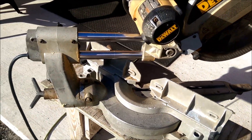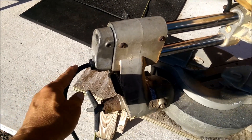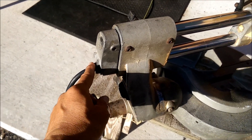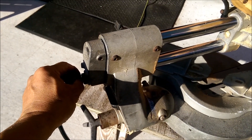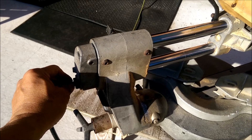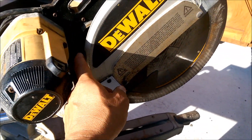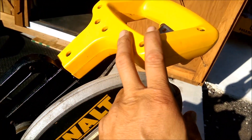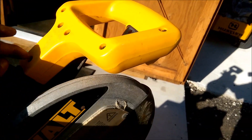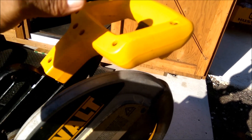So for a quick recap: the plug coming out of here got frayed over time and it was exposing one of the wires — actually both of them were becoming exposed. What I did was I ran a channel here, chased it through here, it comes up behind this panel and inside the handle housing. You take out the torx screws and the handle half comes right off.